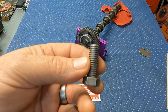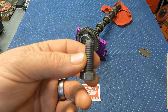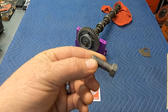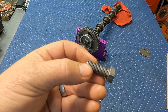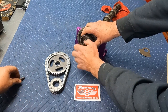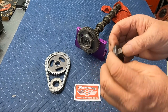And all of your high performance fasteners, you always want them to go in smooth and be lubricated so that when you apply torque to them, they go on with as little friction in the threads as possible, so that you're applying as much torque to the head right here in threads and actually clamping. But people have used this with success. If you have one of these, just understand that there's a certain amount of friction going in, and you might have to put a little bit more torque on it to overcome the amount of torque you're losing with this thread friction. But this is the later model bolt. This is just a free spinning bolt, and of course Ford generally didn't have markings on a lot of their bolts, so is this a grade 5 or a grade 8? Well, we really don't know. We typically will use a grade 8 or better new bolt.